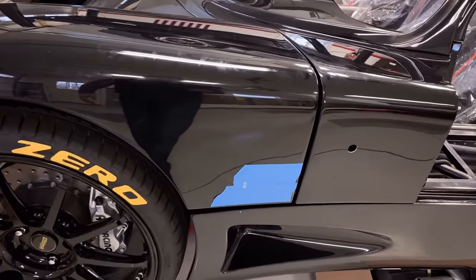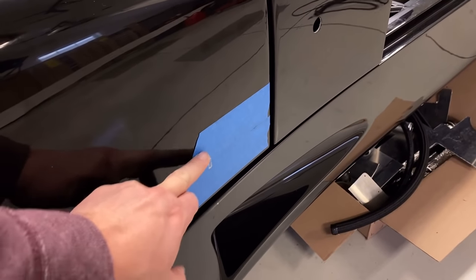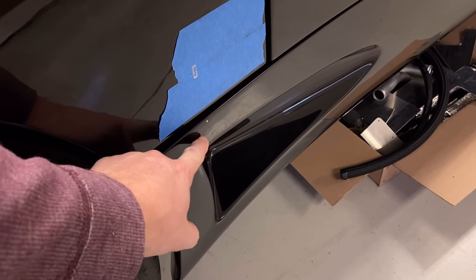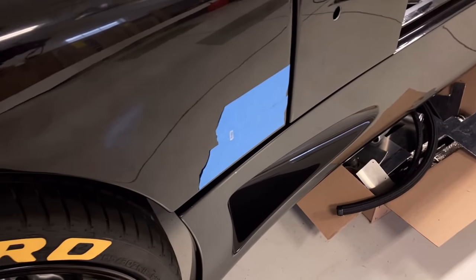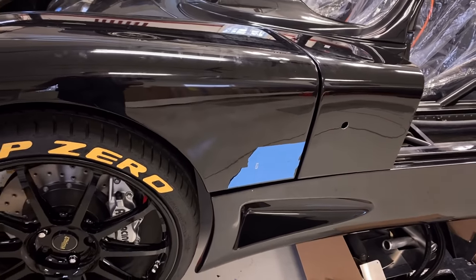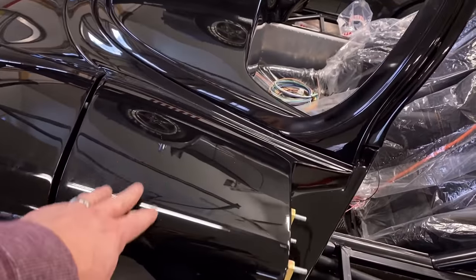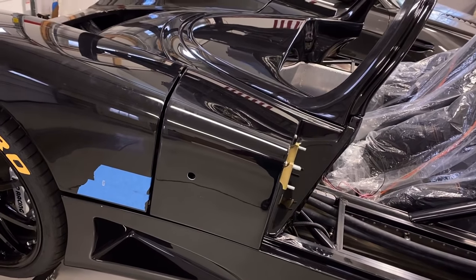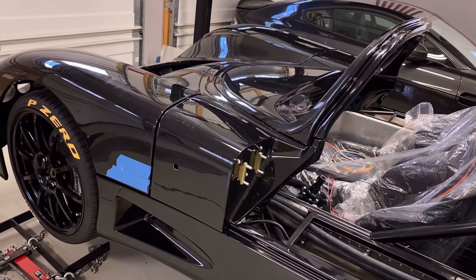So I decided what I'm gonna do, the Aerocatch latch is gonna go here on the side. The pin is gonna go on the side pod panel. I think I'll get the pin installed, but I'll wait on installing the latch until after the body is all in place permanently. Again, this center pod is not secured at all, aside from a couple of clecos when the pre-fit holes are lined up.